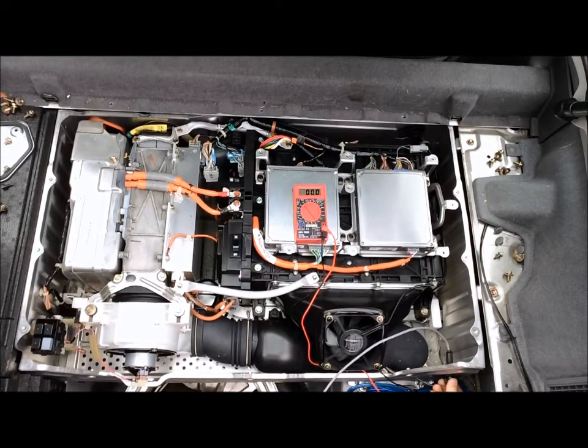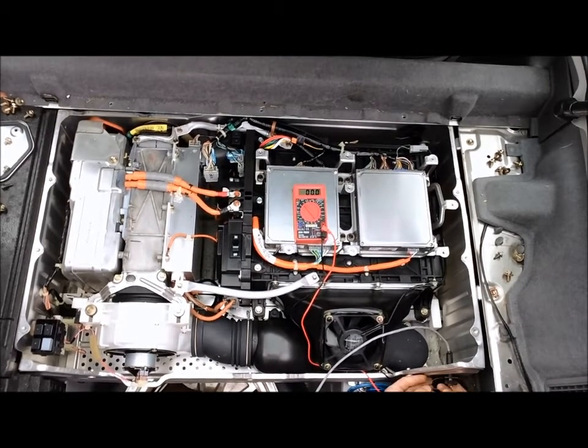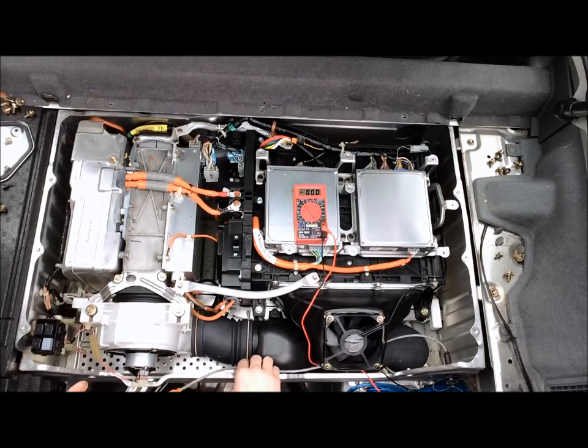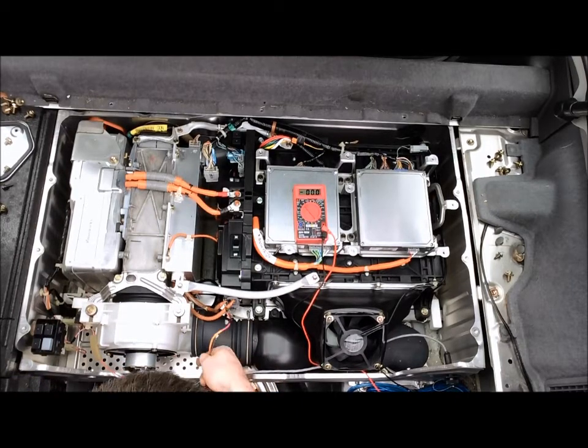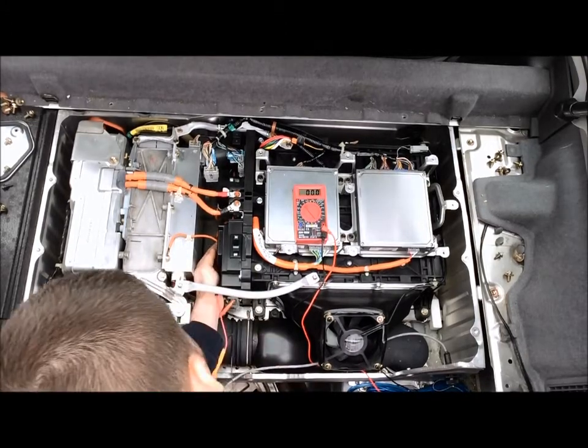So we'll have plenty of room to drill our pilot holes to connect our charging port, and on one of the holes you want to put this strap underneath before you put the screw in there, so when you open the dust cover here, it'll have something to hold on to where it won't get lost. As far as routing the wiring, once you get through the case here, you can go underneath the fan here and around, and I like just going right around and underneath here.